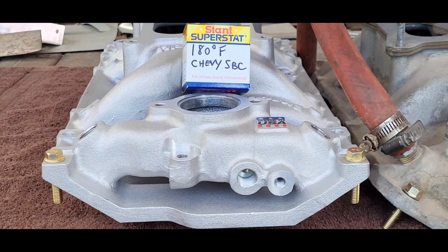Without installing the connection between the two, like a hose, it will result in a possibly cracked block — something you don't want. It has happened. Now, as ingenious as racers are, someone came up with drilling holes in the thermostat, and it works. Not something I'd do, but people do it.